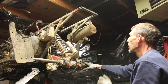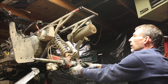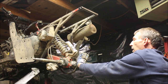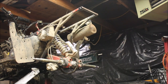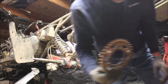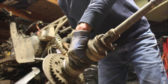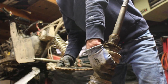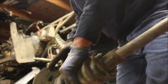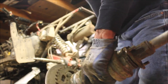I'm going to leave it a little loose because I'll have to adjust this once I put the chain on. This carrier is oblong, so when you spin it, it actually makes the chain tighter or looser. This came off a 400, so I wonder if the gear ratio is different — I think I'm going to use the 500 gears. The teeth are a little closer together; you can see that in the camera compared to this one. So I'm going to take that off and install that on there.